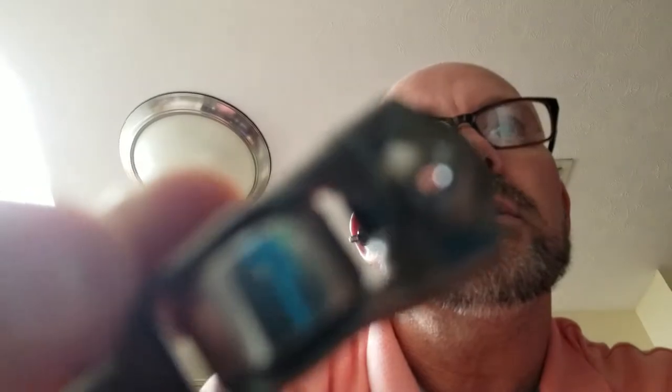So we took another one out of a bag and went through about eight or ten of these things to see if this was just a fluke — and it wasn't. This is a brand new Ford cam follower from the local dealer here in town, and that part number has a major defect in it. There is absolutely no hole — you see no light. I've tried pushing liquid through it, tried putting a small pin, needle, paper clip — anything I could try to get through there. But the original one has a clear hole through it, which you can clearly see. The idea behind this video is to inform you — make sure you check that before you go slapping it on there, otherwise you're going to absolutely destroy your camshaft from oil starvation.